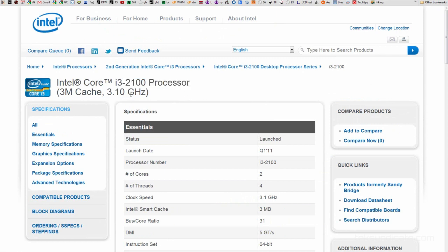The CPU is the i3 2100 at $120, and it does beat the AMD CPU we're using in most gaming benchmarks. The AMD CPU — the Phenom II x4 965 Black Edition — is quicker for desktop tasks most of the time, especially in applications that take advantage of more than two cores, like rendering. If you're using Handbrake for x264 encoding, the AMD kills it.